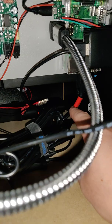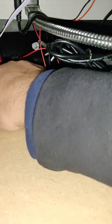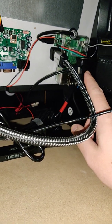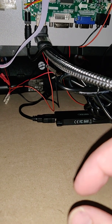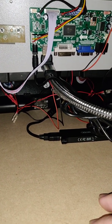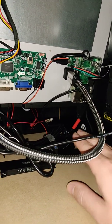This is the USB cords from the arcade controller — there are two here. Over here I have a USB hub, and that's where I have the Dell speaker which is in the back, connecting via USB. This is a powered hub. I decided to go with a USB speaker — you can control the volume through the software, whether you're using retro mode or EmulationStation. You cannot control the volume through the knob here, but I like that it's just USB. I prefer that over analog. To make sure it's powered and I don't take all the power away from the Pi, I connect it into a powered USB hub, and it works great.